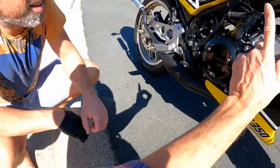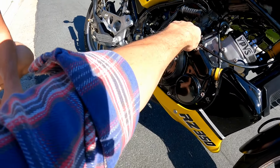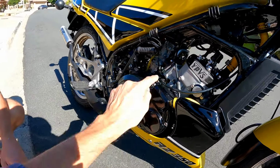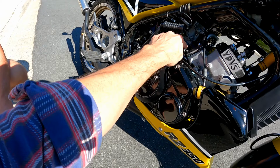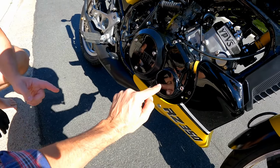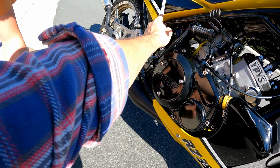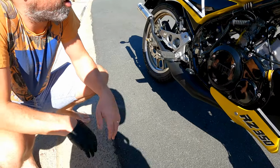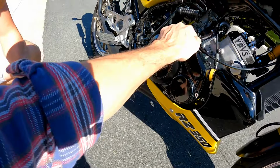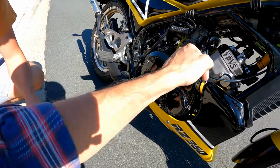And removed the oil injection. This had a mechanical injection. You can see the little nipple on the carb. Each carb has this nipple, had a line running down into here, and there was a mechanical motor. Then there was an oil tank on the other side behind, pulling oil from the oil tank and pushing it into the carbs to lubricate the crank bearings with the gas.